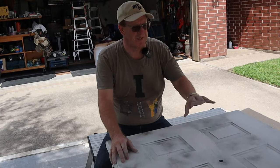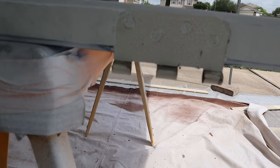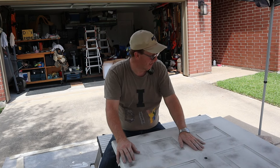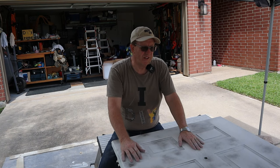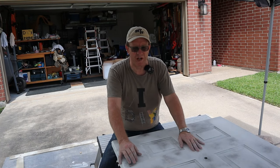A couple of issues came up since I put the primer on. I had to stop for about four days and come back to it, and lo and behold, I've got surface rust coming all through the primer. Just so you know, primer is porous — and this proves it. You can see rust came through, and it's especially outlined where I did the previous Bondo work, but it's rusted everywhere — on the hinge, in areas with no Bondo. So you're going to have to go through, unfortunately, sand this all back down to metal, re-primer and paint in one day. I also found three more low areas or dents I'm going to fix while I'm at it.